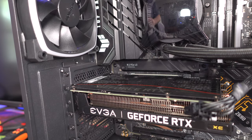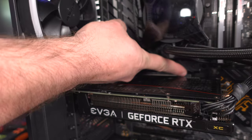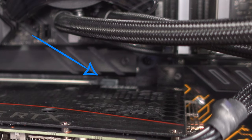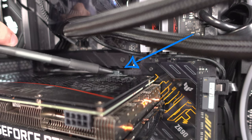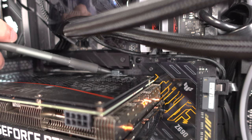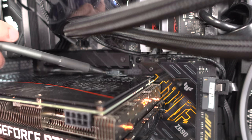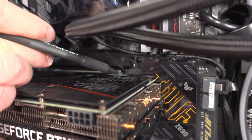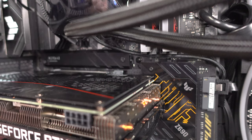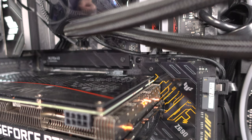One thing keeping the card installed — besides the PCIe slot — is a locking clip that holds the card in place. You can see the piece of plastic locking the card. If the system is standing up, keep your hand underneath the graphics card. I'm demonstrating with a plastic-tipped tool — just push that clip in to unlock it, and you'll notice the card pull out slightly.